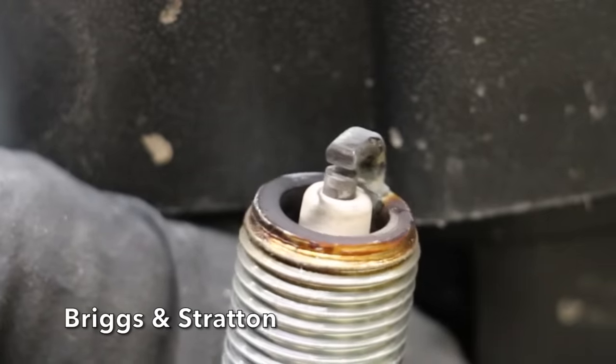After running the engines for 48 hours, the Harbor Freight Predator used a total of 56 pounds of gasoline, the Honda used 57 pounds, Briggs & Stratton 59, and Honda clone 60 pounds. Let's test engine performance using a go-kart with a new drive belt for each engine. Chaining the go-kart to a tractor to compare bottom-end torque: the Honda clone, rated at 7.5 horsepower, barely made it to 200 pounds of pulling force. The Honda, rated at only 5.5 horsepower, easily outperformed it at 239 pounds. The Harbor Freight Predator came in at 233 pounds, and the Briggs & Stratton reached 213 pounds before running out of steam.